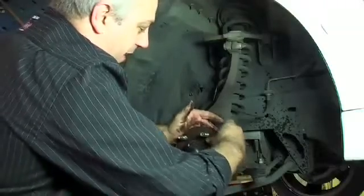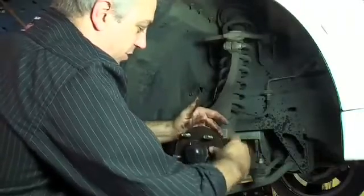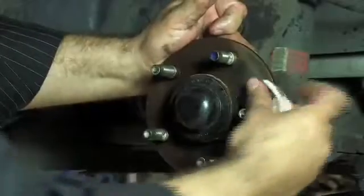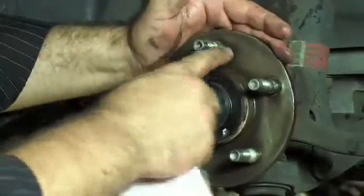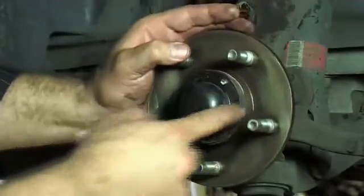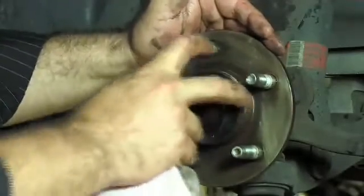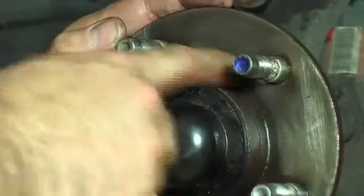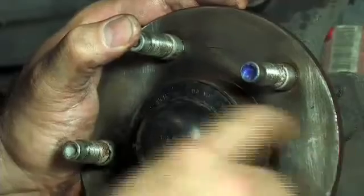It only takes a very small amount at this level of the disc and the hub to cause a major issue at the outer edge of the disc. So now we can remove the rusty fluid that's been lubricating it as we clean and we can actually see how well we've cleaned the hub. It's obvious you can see the parts that we have missed which need to be cleaned up still. It's very important that we remove all of these rough areas, and we'll now be able to focus on cleaning the spigot as well so the disc will sit properly and locate correctly. Now we can see that we've managed to clean away the rust scale and get it nice and clean. You know it's clean enough when you can actually see the machining marks on the face of the hub.